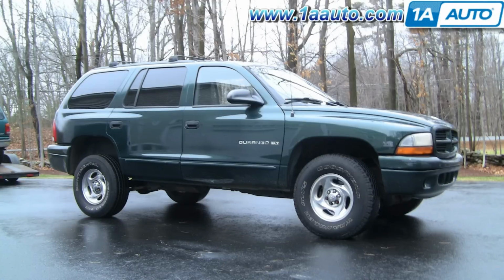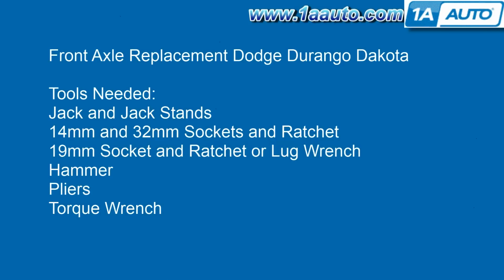In this video, we're going to show you front axle replacement on this '98 Durango, same as any '98 to '03, and also '97 to '04 Dakota. Obviously 4-wheel drive. Tools you'll need are jack and jack stands, 14mm and 32mm sockets and ratchet. You'll either need an impact wrench or a large breaker bar or a pipe for leverage. 19mm socket and ratchet or your lug wrench, hammer, pliers, and a torque wrench.